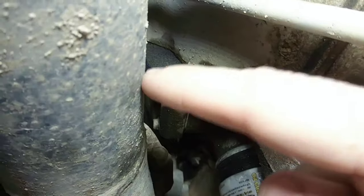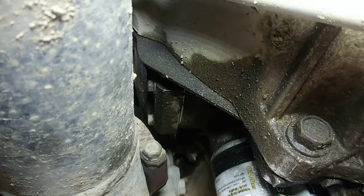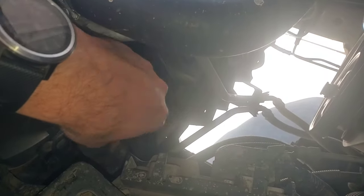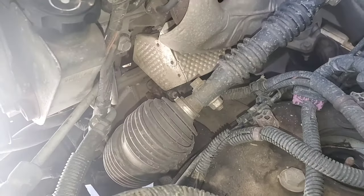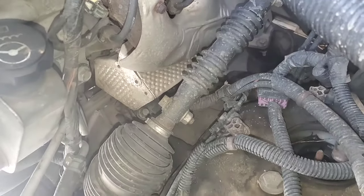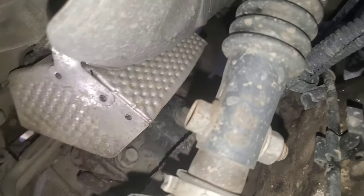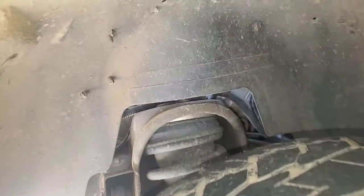And here's the back end — this is your bell housing, the front drive shaft. If you scoot your eyes up there and gander, you'll see that block leaking in there. Up on the front side, these go into the radiator for an oil cooler. Run along there, so now you know what you're looking at from up top. I think if we get rid of this steering intermediate shaft, it'll give us enough clearance to get that engine mount out. And then if we get the engine mount out, we could probably scoot the lines up over the axle — that sounds easier than dropping the front end. I'm pretty sure we're going to have to remove this inner fender well if we want all the access we need to get this job done right.